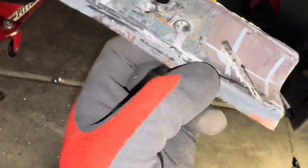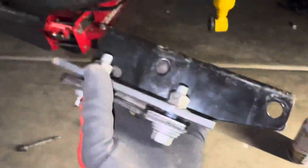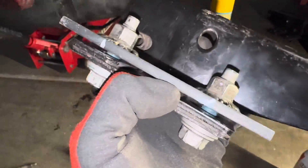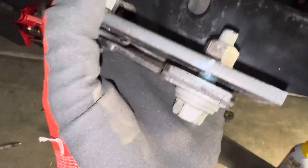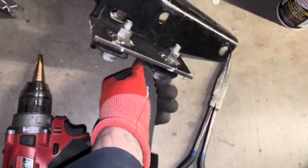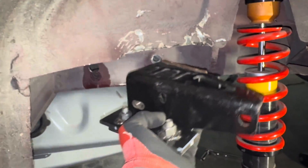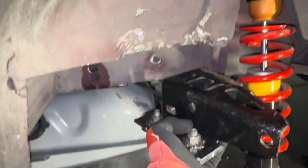I'll make my own plate for it which is going to be a lot thicker — not double-layered like these two thin pieces. I'll lay it in there and it'll have the threaded holes. There's a certain way you should cut it so it just slides right into place and it'll be way easier. Get your measurements right, but basically you're just going off of the bracket. All these fox bodies are not the same — you could take measurements from here to here and the gap from the center bolt hole will be different on every car.